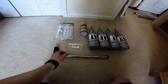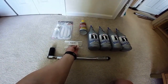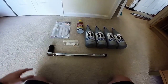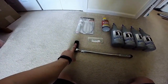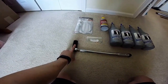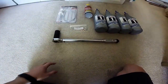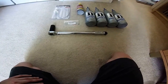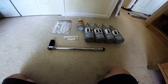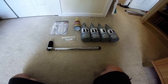I did have to buy some additional items, including a hand pump to get the oil in there because it's an odd angle to pour it in. I got a crush washer set on Amazon — this covers the rear differential, front differential, and transfer case, so I'm set for future videos — and that whole set was about $6. I also had to buy a 15/16ths or 24-millimeter socket for the fill and drain plugs on my 2014 Tacoma, another $6. I got a torque wrench on sale for $25 at AutoZone or Advanced Auto Parts.